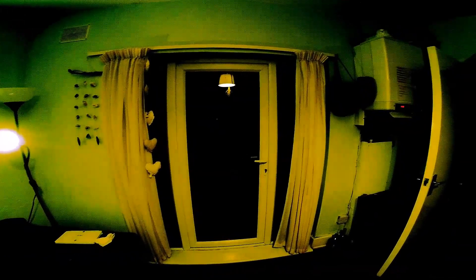Most of them not as bad as this one, but they do show vertical lines and colors that come and go — green, purple. After doing a little bit of research, I think that this problem is related to the fact that the light sensor is gone. These CCD sensors can deteriorate and eventually fail. So I've ordered a new one and I'm going to substitute it on this camera. I'm going to show you how that is done, and hopefully that will solve the problem. We will see.